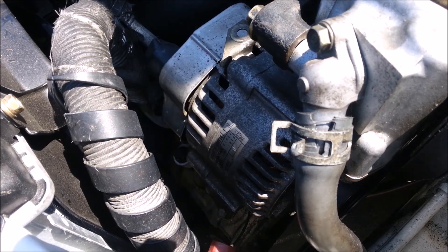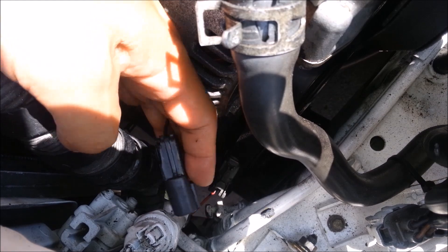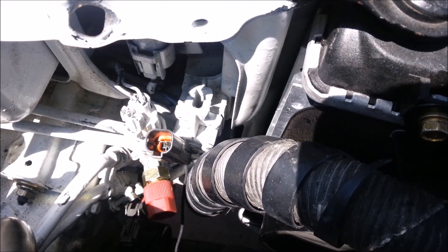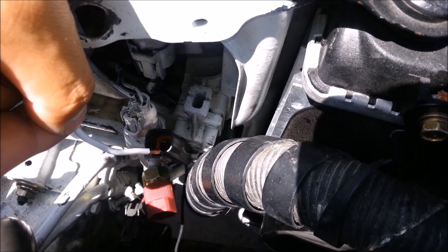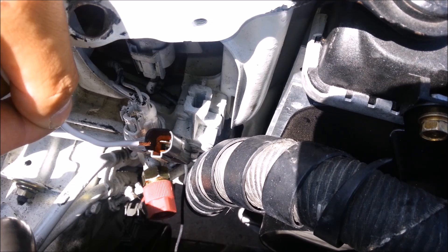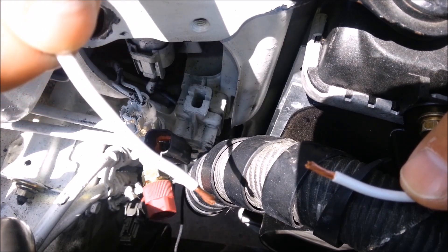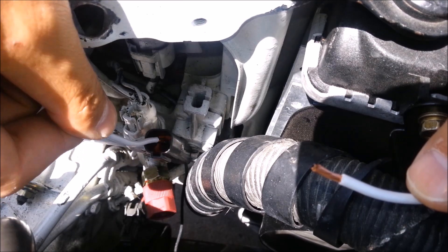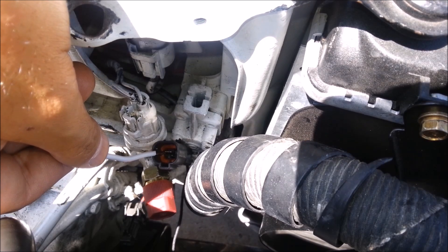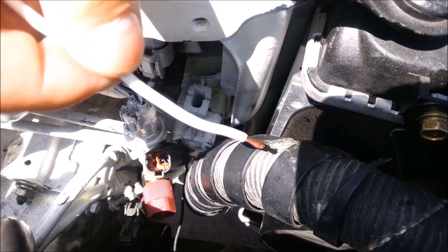The way I'm gonna do that is with this wire. First I disconnect the compressor switch - you see that, it's just a clip. With the engine running, I'm going to take this and attach it to that, while I take this line and attach it to the positive battery terminal. Be careful when you do this - if you connect this end first, it becomes live. So what I would do is touch that first, and then tap it on the positive terminal, so you don't touch any of the other electricals.